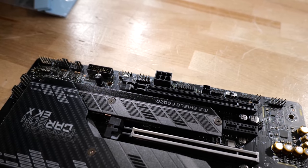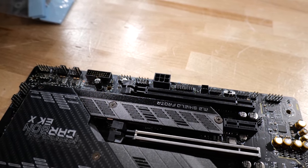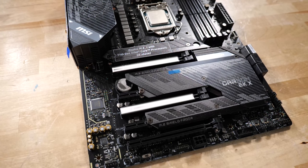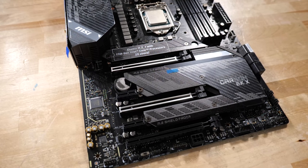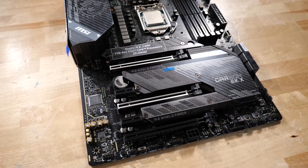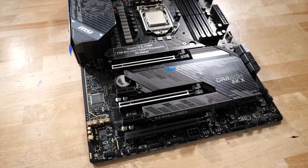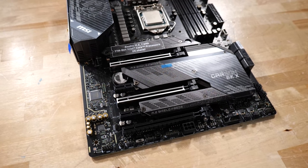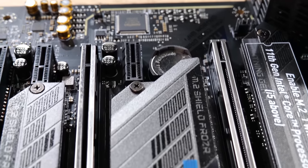Also note that this motherboard has built-in six-pin power for supplementary power, because your GPU can draw up to 75 watts from the motherboard as well — it's supposed to use the 24-pin connector for that. Before we get to the monoblock, let's take a quick tour. You've got two reinforced X16 slots that'll operate at x8/x8 at PCIe 4 — pretty awesome. Not every Z590 motherboard provides that second slot with PCIe x8 through the CPU. Then there's a PCIe x4 slot at the bottom edge routed through the chipset, and two PCIe x1 slots also through the chipset. There are a total of three M.2 on this board, although with a 10th gen CPU only two of them will work.